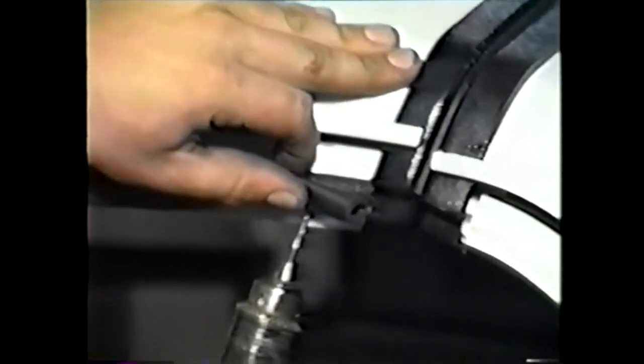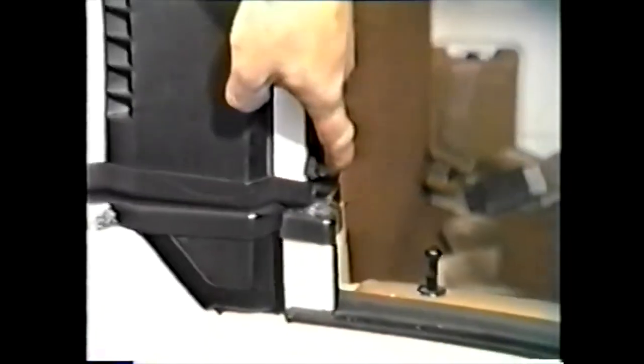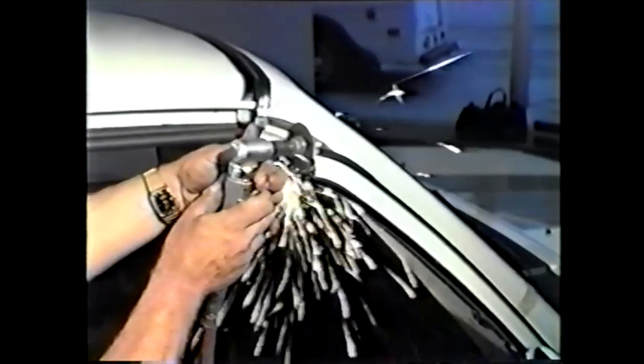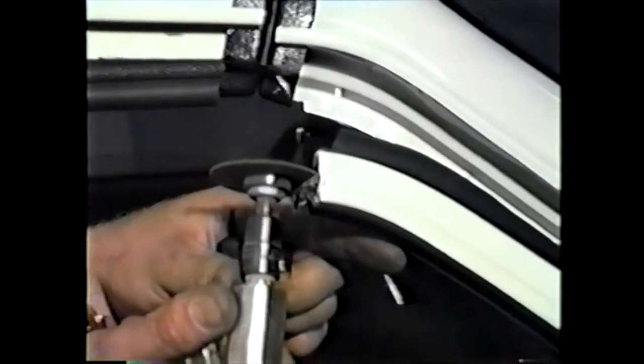And finally, install window seals. Use super glue or a hot glue gun to close in the openings at each end of your window seals. This will allow the window to properly roll up. Next, make final trim adjustments to the upper window frame and install end cap. It may be necessary to trim a little bit extra off of the inside. Now, trim your window end caps to allow the window to roll up into. Use a rat tail file to finish off.